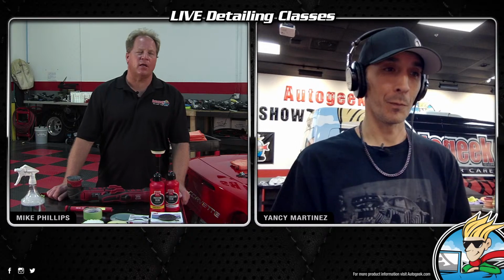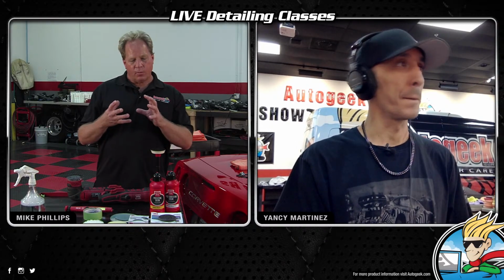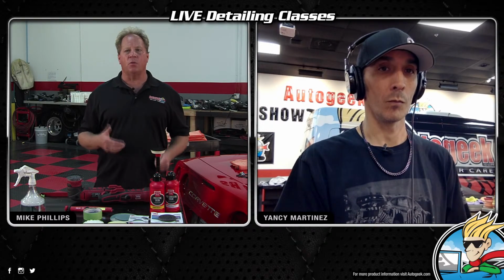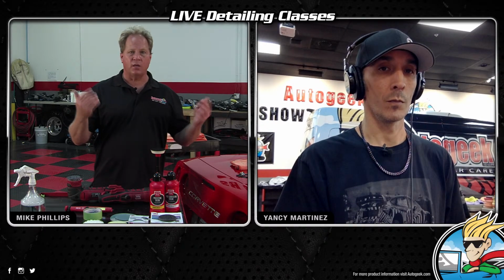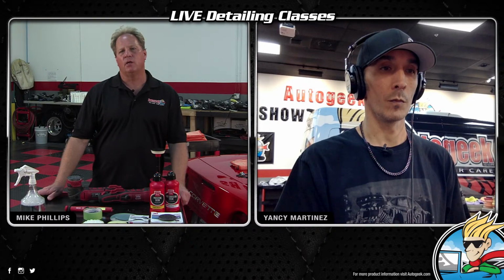Here's the deal. The thing about all these ceramic products out there is when the product itself is exposed to air, that's when it's going to start to cure and set up inside the bottle. So you won't know until you try and use it. What I would do is prep a section of paint that you want to use it on the car and spray some on and see how it worked. If it looks like it's working good, go for it. If it doesn't, then it might be time to toss it.